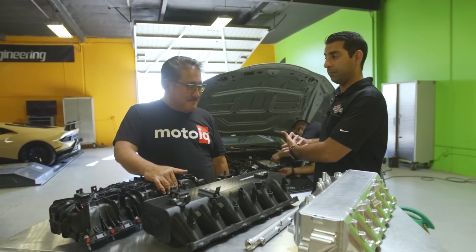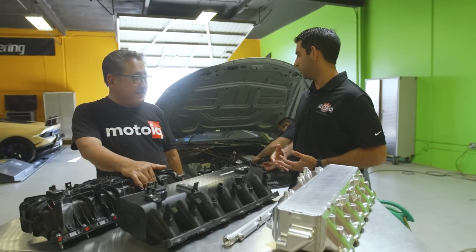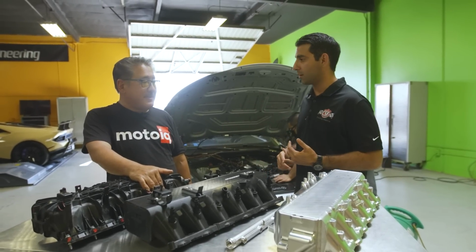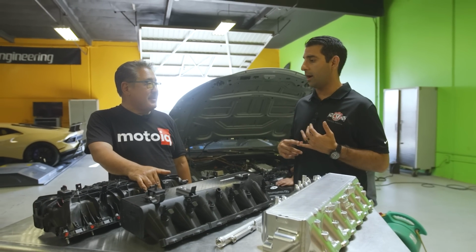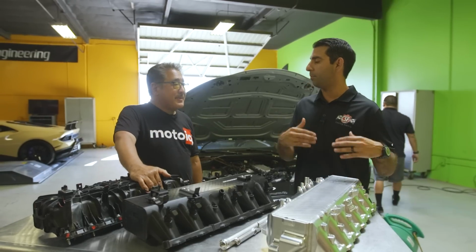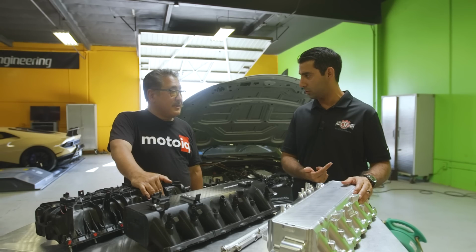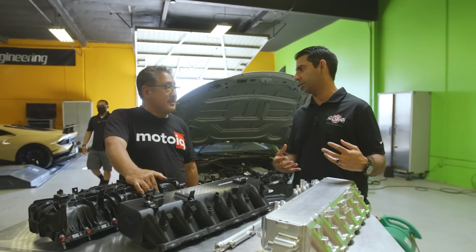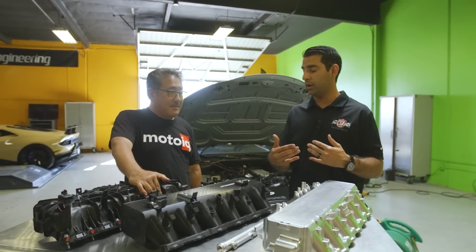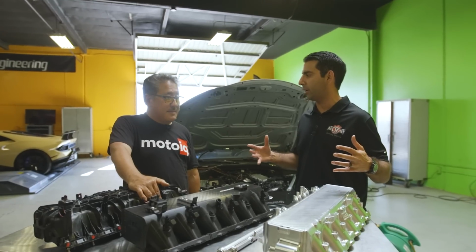Underneath the Supra is really a BMW, and a lot of these cars are now made very similarly, which is there's a cooling pack in the front, and that contains the engine water radiator, also the water radiator that cools the charge air water, so an independent radiator that's got the water cooling down, which then goes through the cooler. Then they also have a transmission cooler in front. Some of them even have an AC condenser.